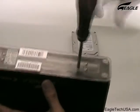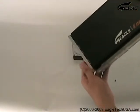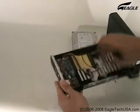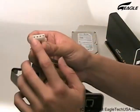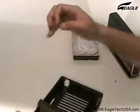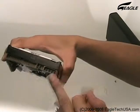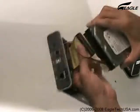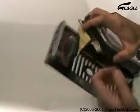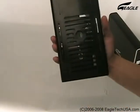Remove the screw and pull out the tray. The tray part is screwed in. This is the IDE Cable and IDE Power Cable. Connect the IDE Connector and Power Cable. Push the Hard Disk Drive towards the circuit board until the screw hole is visible.